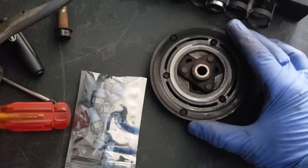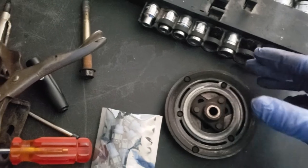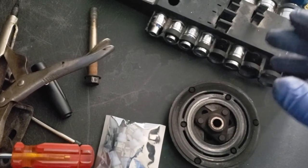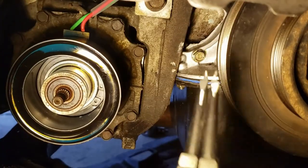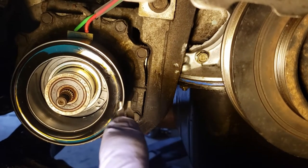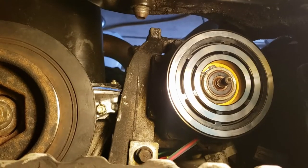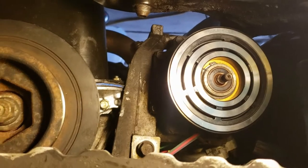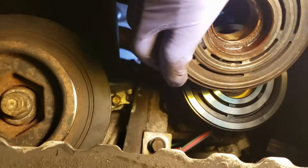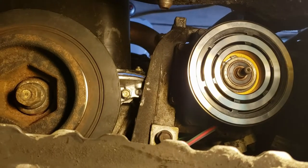However I still don't know what the issue was because it just wasn't responding electrically. I would short it out to the battery and there was absolutely no click — no anything — so that made me think everything was bad. I had to grind off part of the jaws just to get better access to the clip inside. The next part of the AC clutch went on pretty well and you can see the clip in the middle is already installed. I used my old clutch and hammered against that and at the last part it just fell right into place.